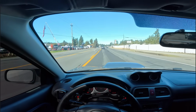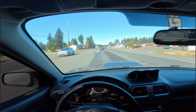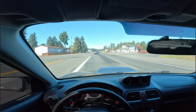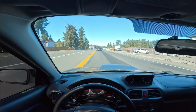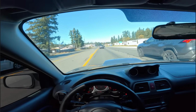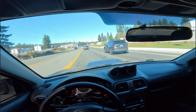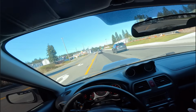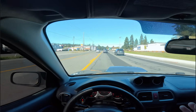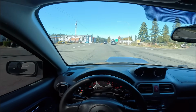There is one issue I have run into with tuning on fine knock learn, and I have not been able to sort this quite yet. It's also feedback knock. Feedback knock is going to be your short-term knock correction. That's an immediate response to what the car sees, pulling X amount of degrees of timing. Now, for me, I think I'm attributing this to the drop-in pistons, because the pistons are not machined to the block. They're literally a 9950 drop-in piston.